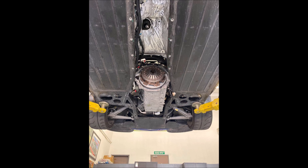The stock one is going to go away in around three or four passes from around 5k — ask me how I know. So when I inevitably kill the shift pads and synchros and need another transmission rebuild, I'll probably throw in an Nth Moto triple disc carbon. But it's not because of the power the car is making — it's mostly for the increase in shift speed and the reduction of weight; it's a much lighter clutch than the stocker.